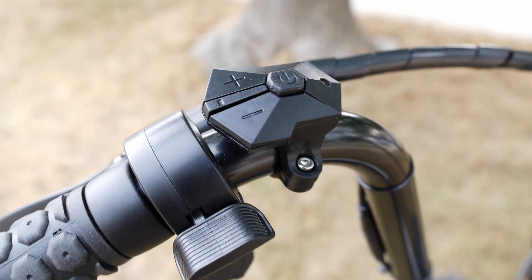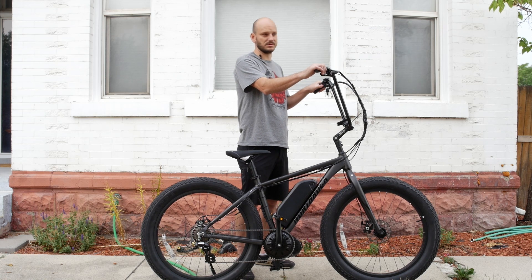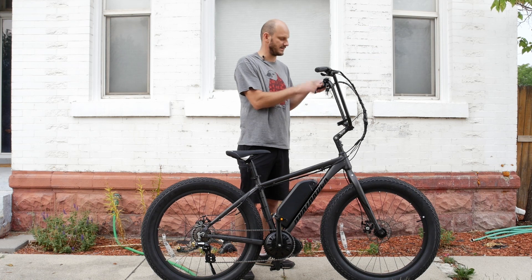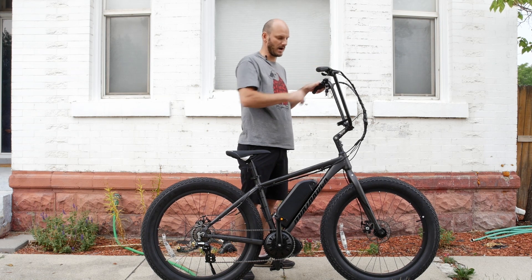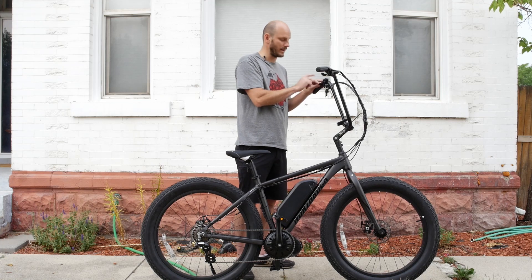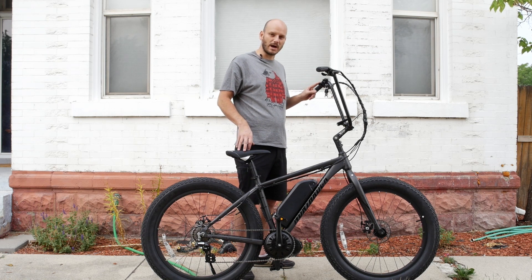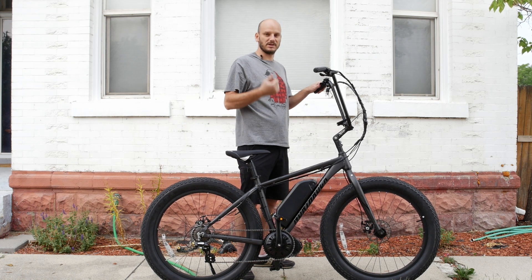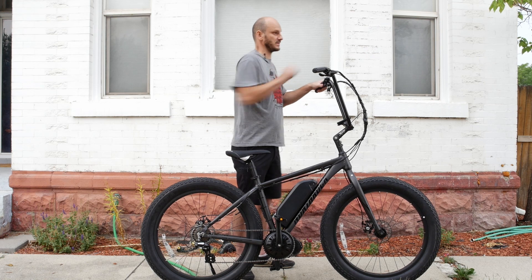It's got a throttle up here next to it. We made the throttle tied to the pedal assist levels, so if you're on pedal assist one, the throttle will only give you a little boost too. If you don't really plan on pedaling much and you just want to cruise down pathways where there's a lot of people, it's nice to have the throttle tied to pedal assist — that way when you hit full throttle in your lowest level, it's going at like eight miles an hour, and you can bump it up to go faster. Or you can program it so the throttle is always set to full speed. There are trade-offs: it can be a safety issue if you're not confident and you accidentally hit it. But if you're crossing a crosswalk and need to get out quick, full bore can be nice.